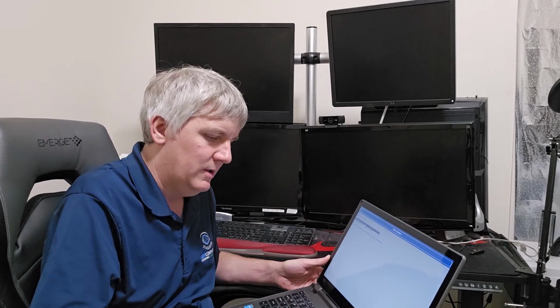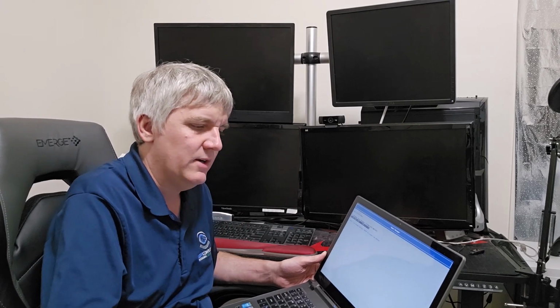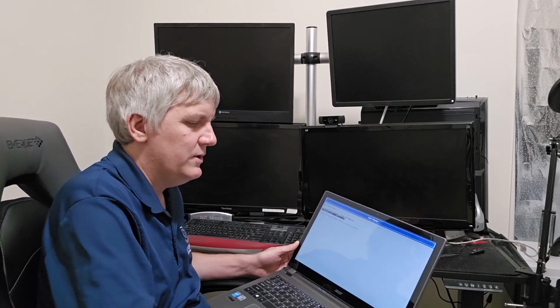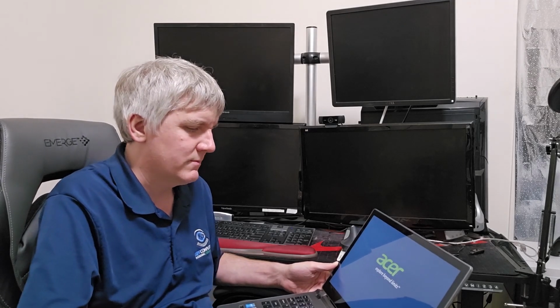Look at that. Alright. PNY is the brand of flash drive. It's a Windows 11. It's a free tool you can make. So you can get that directly from Microsoft, or you can use Rufus. I guess maybe it was just Rufus and the Windows 11 ISO from Microsoft to download. So it's not hard.